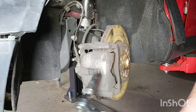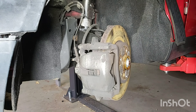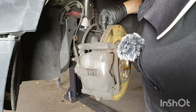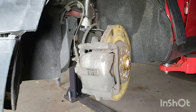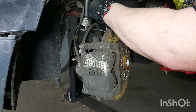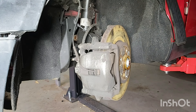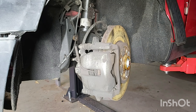I'm starting by removing the 18mm nut and bolt on the bottom of the suspension strut, and then going on to remove the speed sensor and the other cables that are there. It's just a case of placing everything out of the way so that it doesn't get damaged.